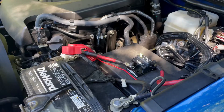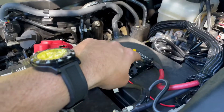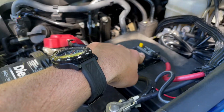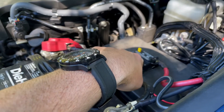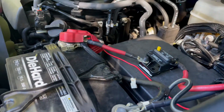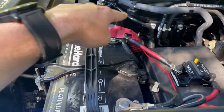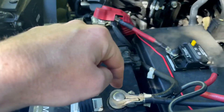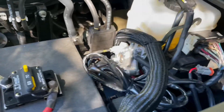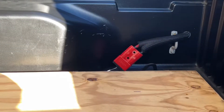Here's how it's wired into the truck. There's another breaker so I can turn off power when the camper is not plugged in, just so I know there's no power running to the back of the truck. The power wire is just run to the truck power and truck ground, and then I have it running all wire-loomed down to the back of the truck inside the bed.